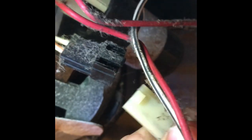And now I want to take off two connectors that are holding the motor arm. First I'm going to remove some of the motor connectors too. So these are just 1/4-inch screws that are holding on these spring clips that hold on the motor. So I got to get these little screws off first. And I'll pull off this modular connector that brings power to the motor. And then I have a pretty big capacitor here that has a couple of wires connected to it, and then one more little modular connector I just disconnected. And I'm going to use some pliers to help me pull off these leads that are on the capacitor.